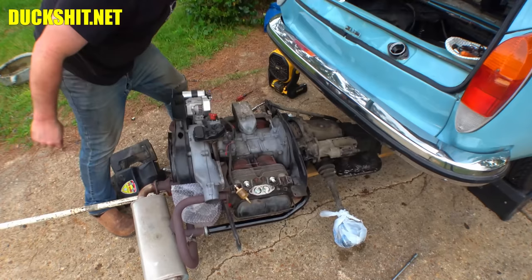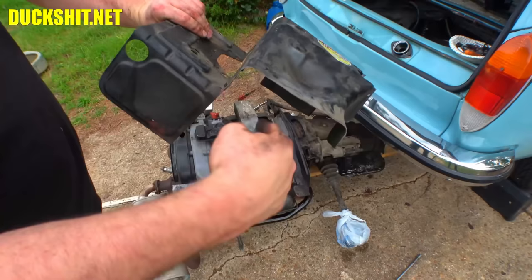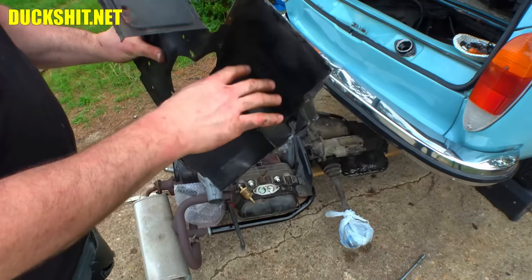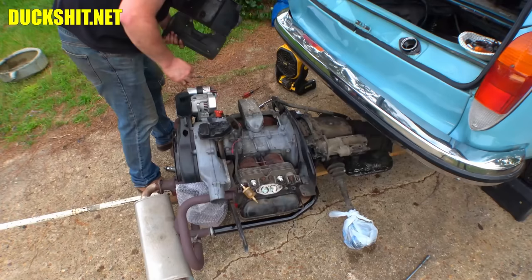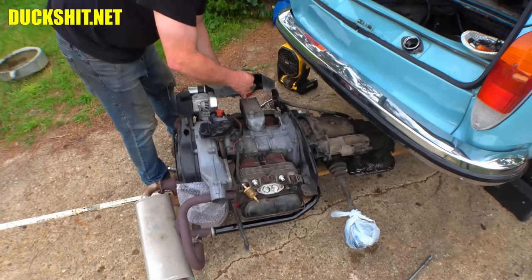Okay, this is our left side tin. We know it's the left side tin because it has the hump over it for the oil cooler. And just on the inside, if anybody's curious, when the air goes into this thing from the opening that's here, it passes through here, through the oil cooler, and then it's expected to go out through the rear chute, right here. So the air is separate from the cylinders themselves, although in the top, they kind of do somewhat share. Air can get, you know, it's not diverted by way of any vanes. So I guess on this side, some of the air, despite the hot air coming off of the oil cooler not going directly onto the cylinders, this side would technically run a little warmer because it is sharing where the air goes and comes from.